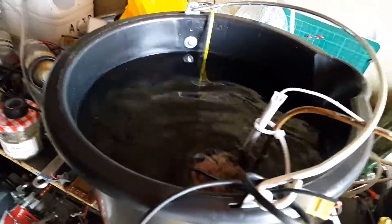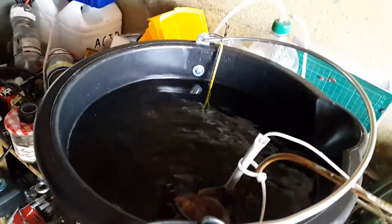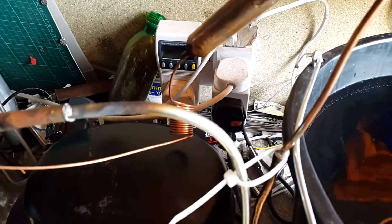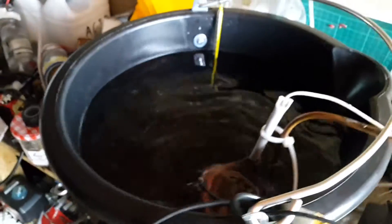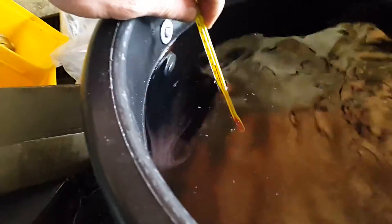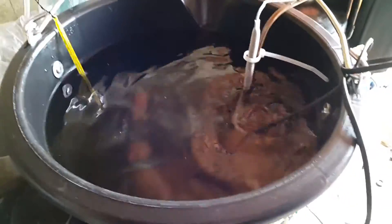One thing I forgot to mention is that it's 16 litres of water there — at least going by the markings on the bucket — and I think there's just a bit less than 12 in here. I've noticed that it seems to shake around a little bit, but I'd imagine that's all the refrigerant flowing through. And under the water, the top of the evaporator still does freeze up. Seven minutes in and from 13 degrees we're now down to 11 degrees, but bear in mind there is quite a lot of water there.